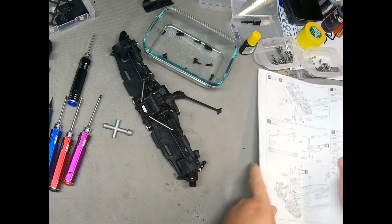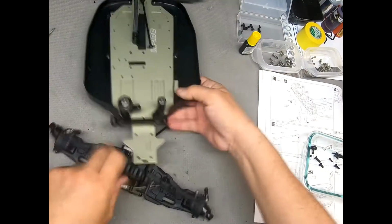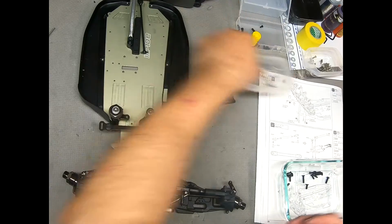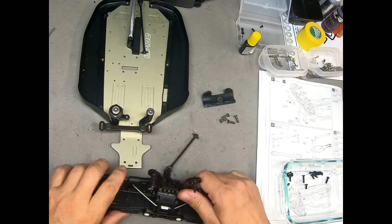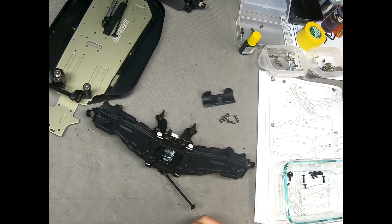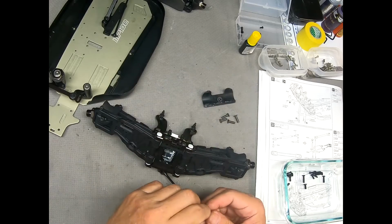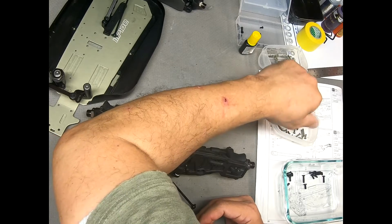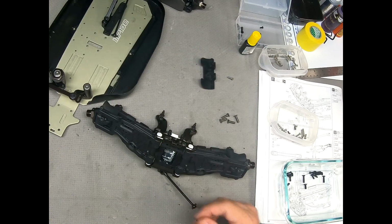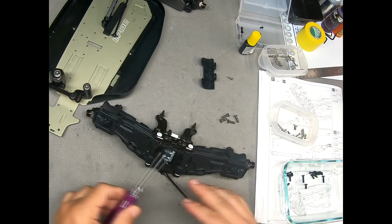And it's time to attach the front assembly to the chassis. Okay, so now I'm gonna go ahead and pre-tap or thread, cut threads into these four holes here. And I'll do that using one of these, and then I will use titanium to put that all together. And then we need a 3x10 button head to anchor on our bumper. So instead of making you watch me go through all this, I'm going to go ahead, pause up, and cut the threads.